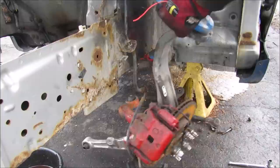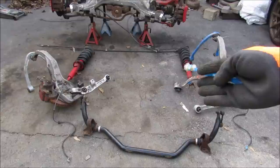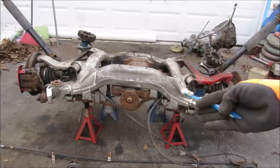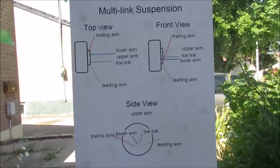With this brace off I'm going to drop down this control arm. Here we have the entire front and rear multi-link suspension removed from the vehicle. At the front we have the front spindle assembly with three control arms attached to it, a strut, and a sway bar. At the back we have the rear aluminum subframe housing the differential and CV axles for this rear wheel drive vehicle, with four control arms on either side, a separate shock absorber, and a coil.